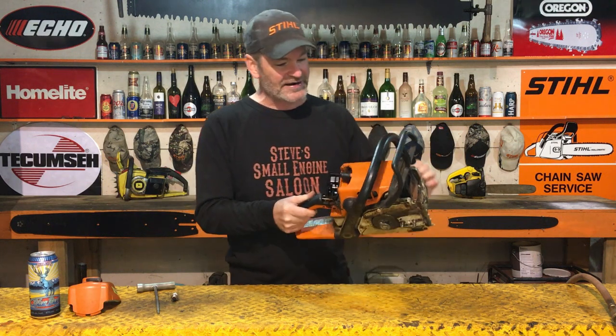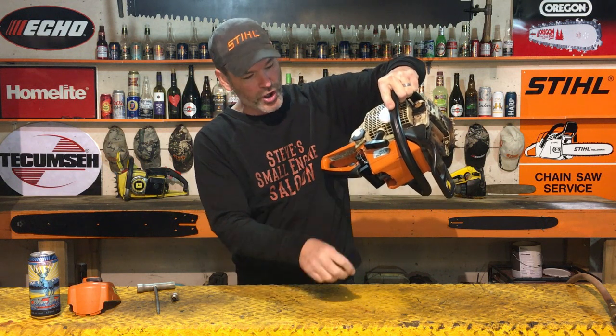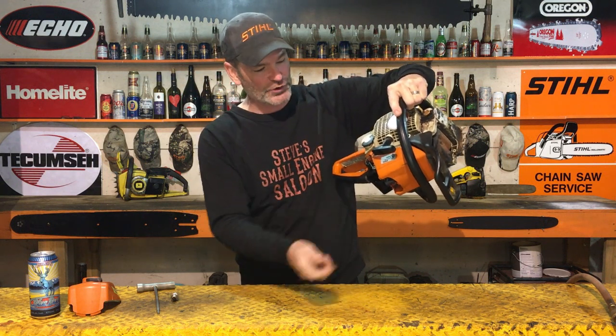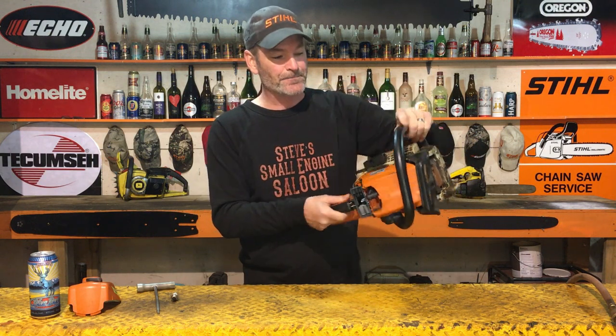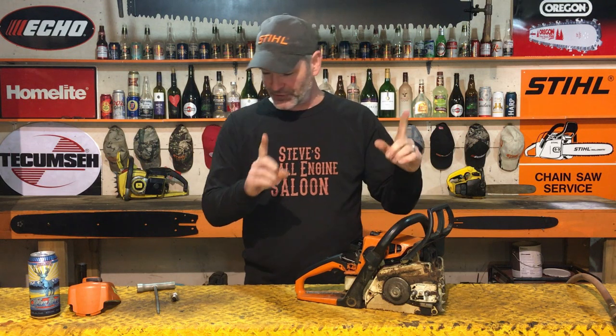We flip it upside down and we pull the rope to blow all the gasoline, the excess fuel, out that spark plug hole to dry it out as best we can. Now, before we do that though, I got to take you through a couple things.